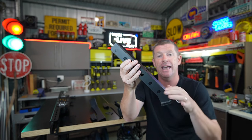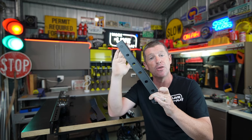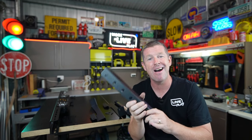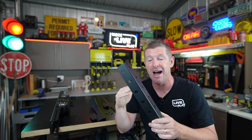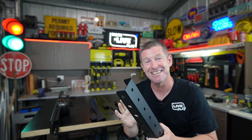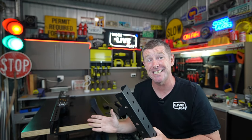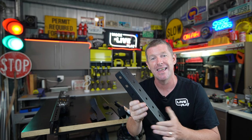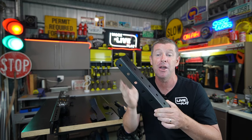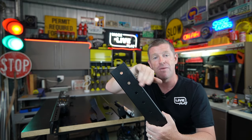The King's tub rack for $250 on special is fantastic value when you're paying $600 or $700 for some of the other brands that seem to be exactly the same. The standard leg has six holes; the shorter PPD ones only have three holes so the rack sits a lot lower. I was actually going to cut this down, but I decided on a standard install because this tub rack is going back off the Ranger — it's a very temporary install and I've got another project it's going onto. So I don't want to hack this up just yet because I think I'll need the height on the next project.